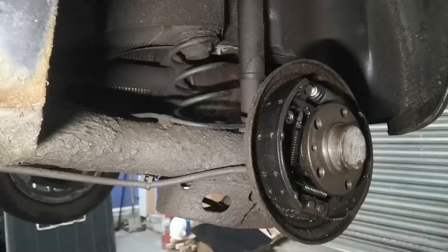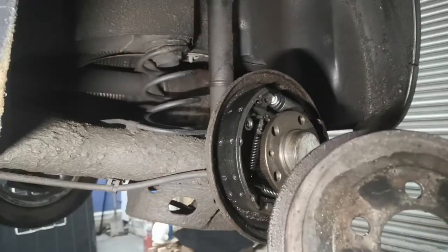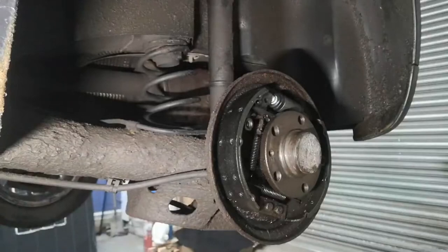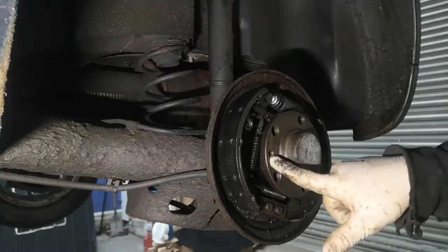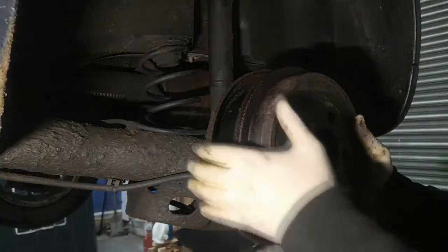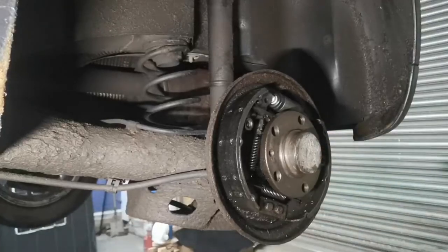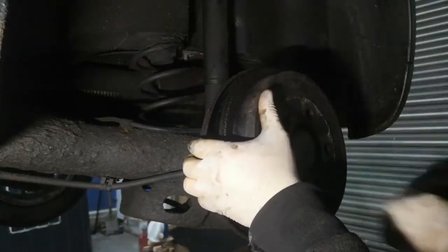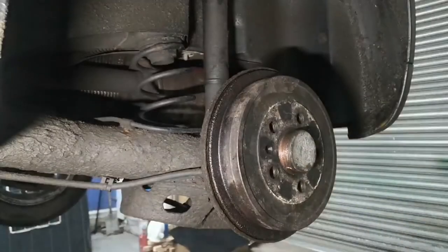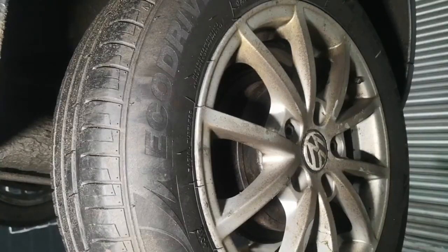Just close off the bleed nipple, then wipe off any excess, and put the dust cap back on. Now I can put the drum back on. I've just cleaned the drum off camera — you can see there's still some brake fluid on the outside, so brake cleaner on the outside. There are five wheel bolt holes and this little hole here — that's what I've got to line up. Before we do that, we'll put some anti-seize on this wheel bearing. That's on now. I'll put some anti-seize on the actual drum so the wheel doesn't stick to it. That's how to change a wheel cylinder on a Polo. Thanks for watching.